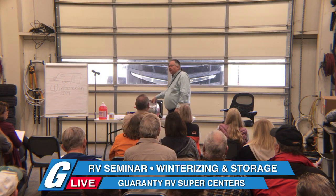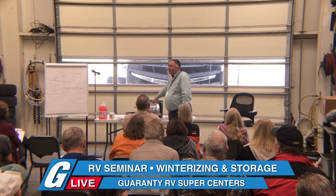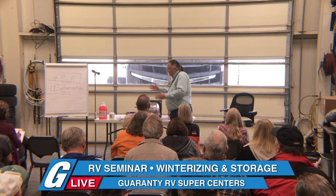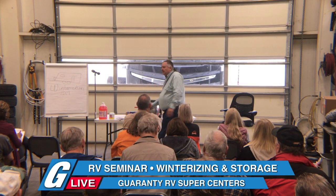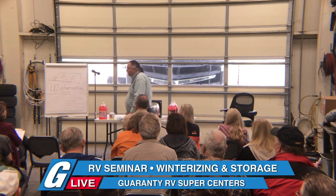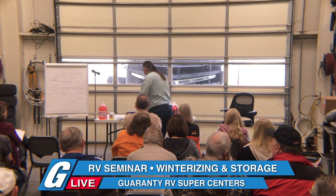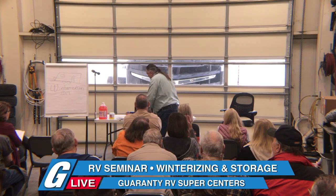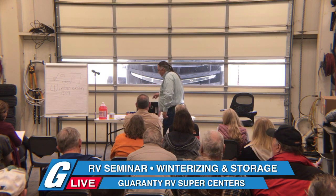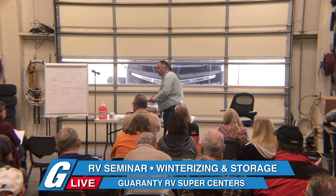The Suburban is a steel tank with glass lining. Atwood is the aluminum. Suburban is probably going to last a little bit longer, but no, it's just different designs. Do you have a question? How do you know which one you have? Can somebody go out and look at it? Well, you fold the door down, and it'll show you on the side right here, or right here, which brand it is.